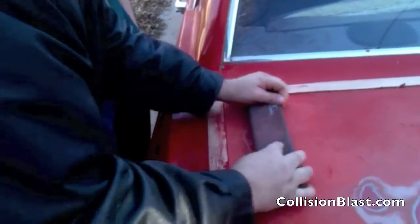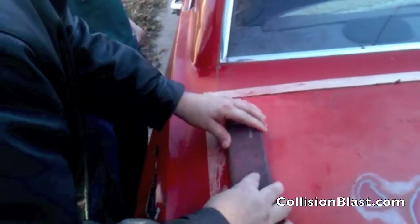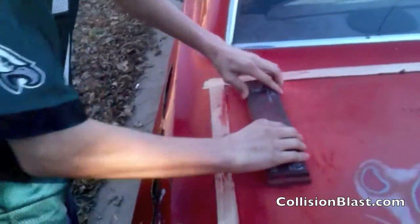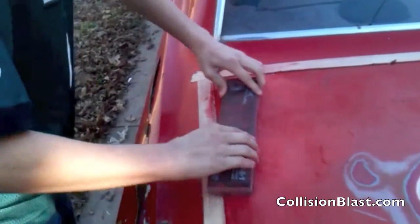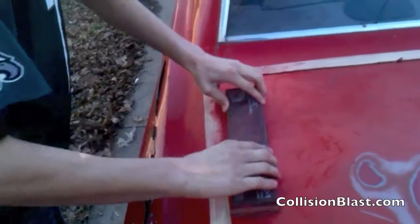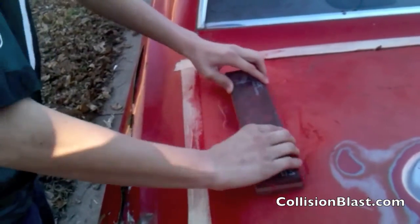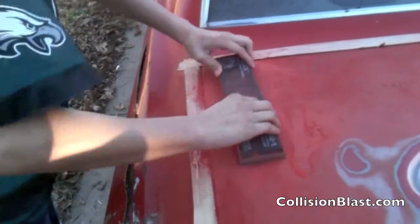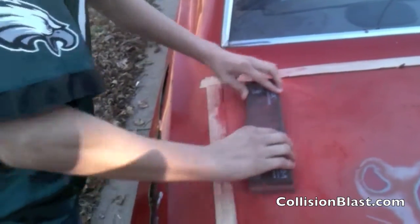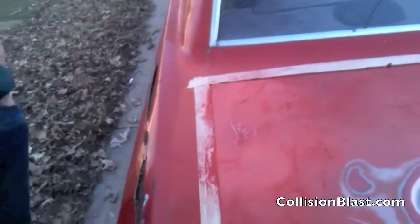Just kind of crossing like that. I'm showing him he's pushing down too hard, making a real jerky pattern. You don't have to push down that hard — you just want to keep it smooth. Give some pressure or you're not going to sand, but make it smooth and easy on yourself and it'll block out fine. Just remember not to hit your adjacent panels. Like any of this, it just takes practice and then you'll build your own techniques and it'll become second nature.